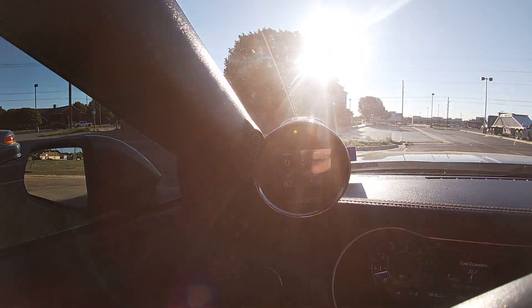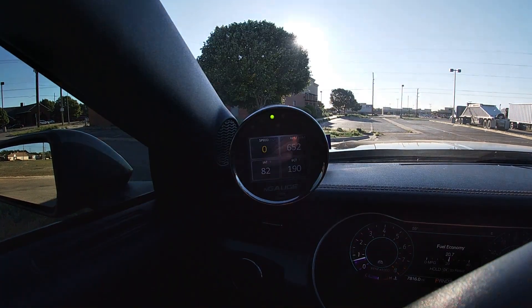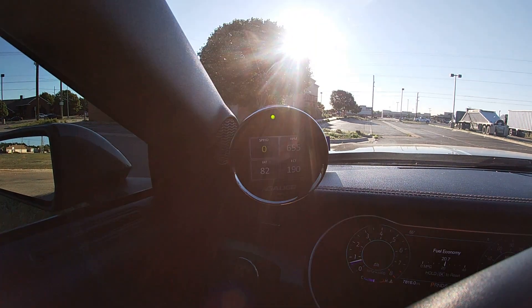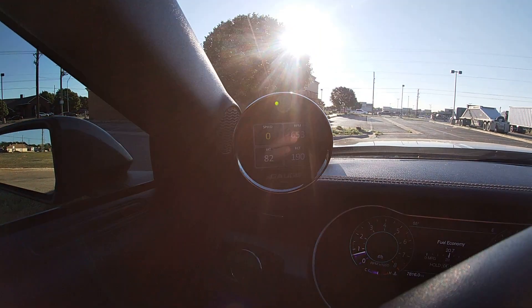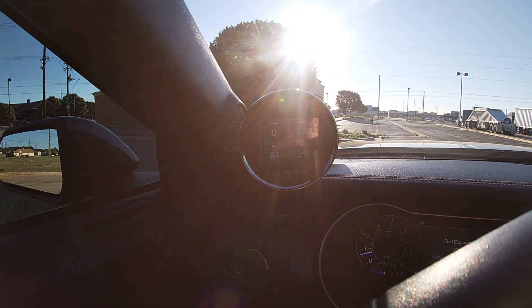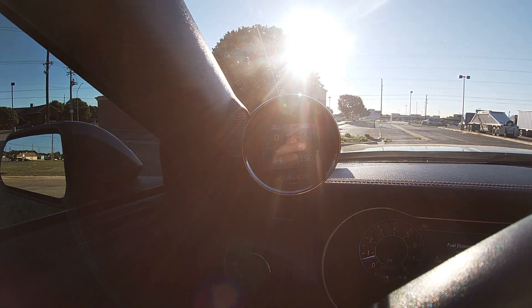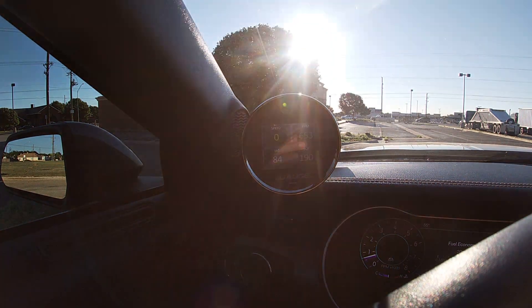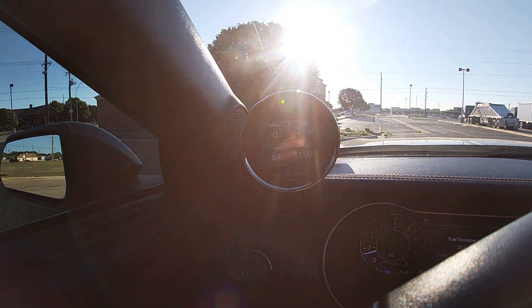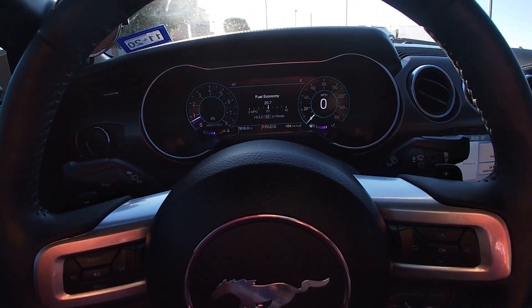It will log that numerically on your SD card under a folder that says 'log' — so it's super easy to find. Once you get home, take that SD card out, load that file onto your computer, and you'll end up sending it back to Palm Beach Dyno. Before you load it, it's probably best to just label that file — change the name to something like 'E85 2-Minute Idle.' That will let your tuner know and probably help him organize and save a little time.